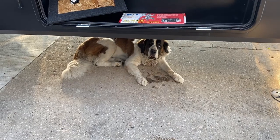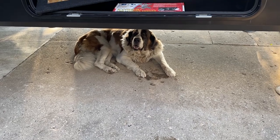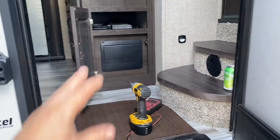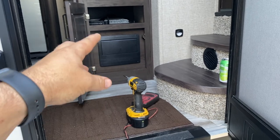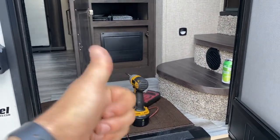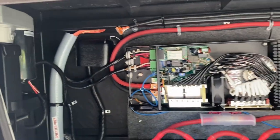We're finishing up on day two and Coco is telling us it's time for a walk. Let's check in on where we're at. I like to take the 6-2, 6-3, or 6-4 wire that comes out of there, run it to the inverter and then back to the panel, wire nut it all together, button it up, and test it — it's working good. Ran the AC lines through there — there's the pair of 6-3 cables — ran that through some conduit, up through there into the hole, then out here and into the Multi Plus.